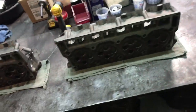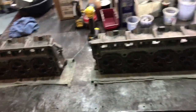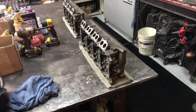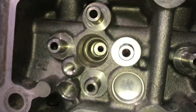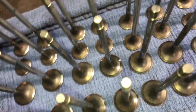These are not the Chinese new casting crap — these are actually seasoned, original factory-installed Ford heads. I'm a big fan of them. I've got some videos showing those Chinese castings when somebody says they got new heads — yeah, I'm not a fan. See how the spring seats are all symmetrical, uniform, and round? The entire spring has something to rest on.